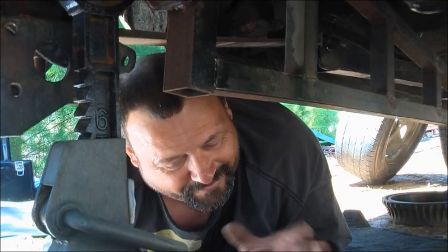Well, I've seen where they said in drag cars, they put more lash in them, like 12, so that the oil gets in between the gears better. Plenty of oil in it. It's got lash to be damned. We do between 5 and 7.